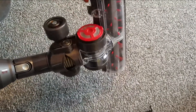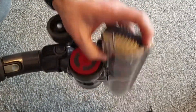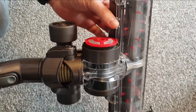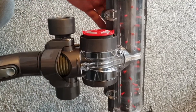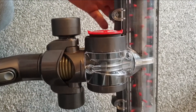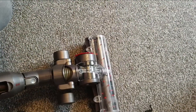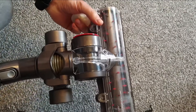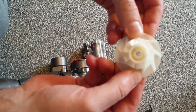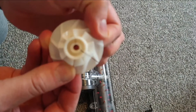This is a video about a common problem with the DC23 head of Dyson vacuum cleaners. Normally the problem is that it's full of dust and the brush just stops spinning. But when you start hearing a cracking sound and the brush is spinning at low speed or stalls completely, the problem might not just be the brush or hair stuck in it — it could be the turbine inside, which is actually spinning the brush, and it could be broken like this one.